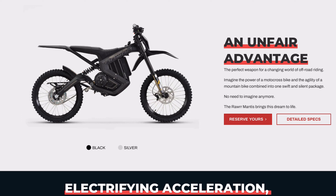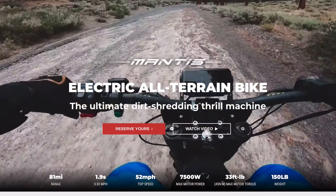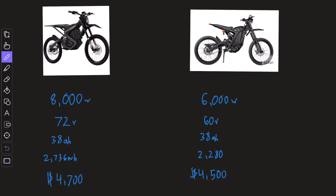As far as I can tell, the Storm Shock uses the same front suspension fork from either KKE or DNM. However, the rear geometry and pivot point is radically different. The rear shock mounts directly to the swing arm, whereas the Sur Ron uses a linkage in the back. That linkage could potentially cause problems because it adds more moving parts — I've seen reports of people breaking and bending the rear linkage — but the point of it is to give you leverage and thus better rear suspension. So I'd say the Sur Ron probably has slightly better rear suspension, though the front is exactly the same.